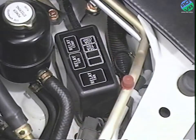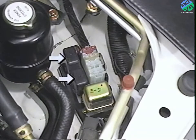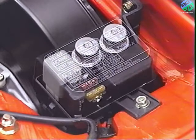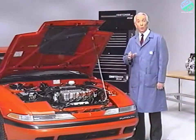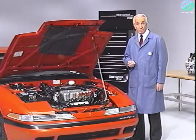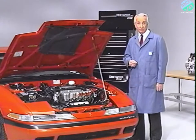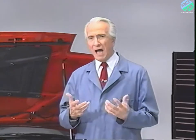The air conditioning relay is also used by the TCU. On the Summit, the relay is located in the left front relay bank; it's behind the left shock tower on the Laser. When the air conditioning is activated, this additional load on the engine requires a wider throttle opening to maintain the same road speed. This type of situation places the TCU in a position of trying to figure out why a stronger TPS voltage signal has not increased engine RPM. So, the AC relay signal electronically explains this to the TCU.